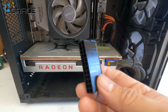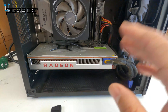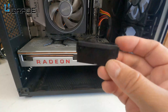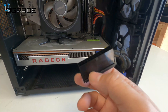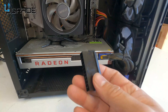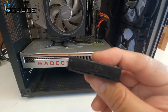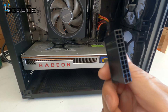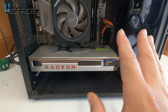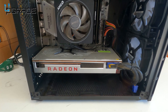Today suspect number one looks like the power supply. If you guys don't have this adapter, you can order it online — it's used to test your power supply without anything connected to it. Normally you need a motherboard to trigger the system, but with this adapter you can test it standalone. Let's disconnect the PSU completely out of the system and do a little time lapse.